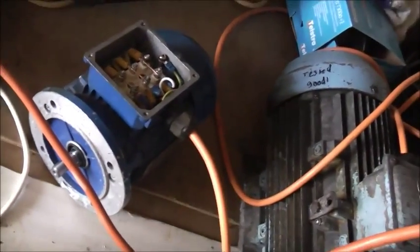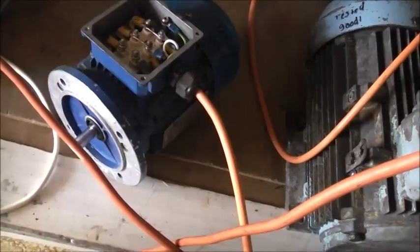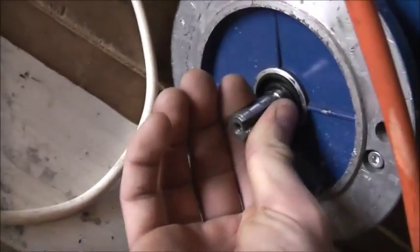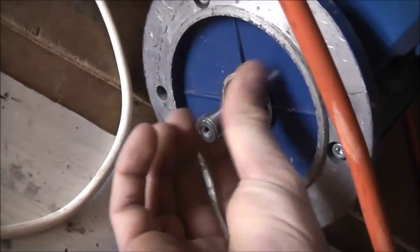The bearings in these motors are not designed for high RPM. This only ramps it down. Notice it doesn't use a relay like a click and slow it down to a halt like this one either. This one puts a big discharge to the motor — that's why you hear a big bassy grump and it goes click and stops. This one doesn't do that. The rotor — the shaft gets hot. The bearings aren't getting hot, just the shaft from the rotor that's getting hot.